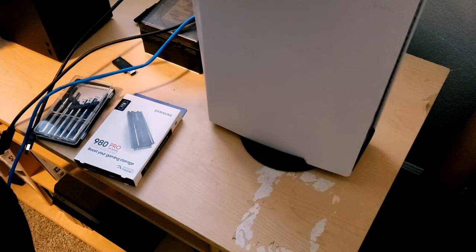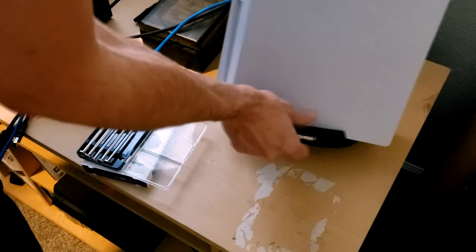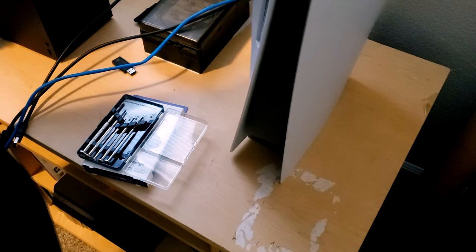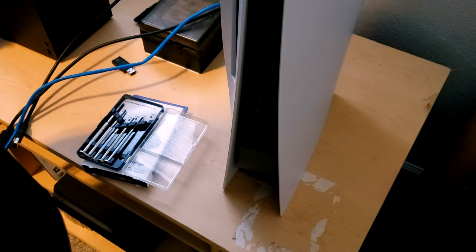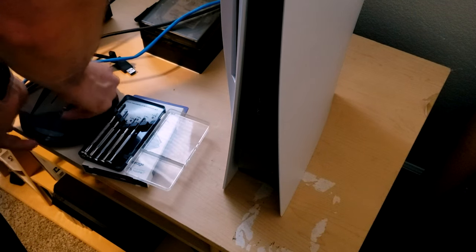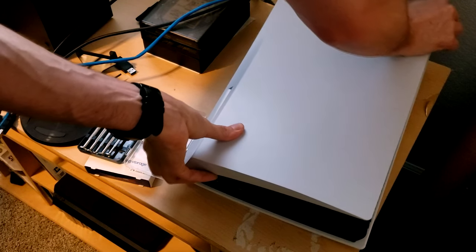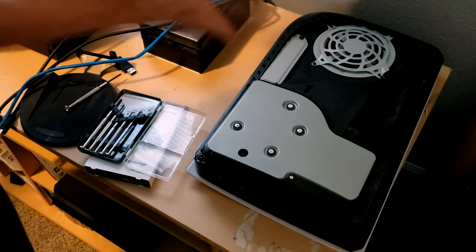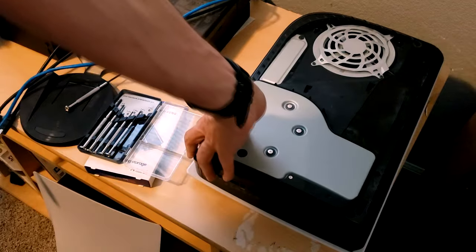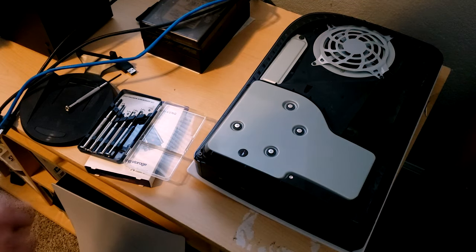All I've got to do is figure out how to take the shell off. I'm going to need to take the bottom screw off. There's a screw holding the bottom plate on, so I'll just take that right off. We're going to grip it down here by the disk drive, pull up on this corner, and then peel it back. It does come down just a little bit and slide off. You just grip it down here and pull that off. Although this step already has been 100 times more stressful than just plugging that module into the Series X.